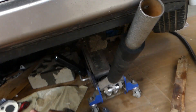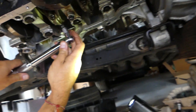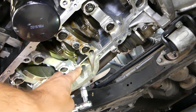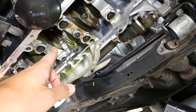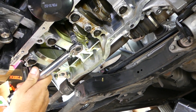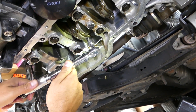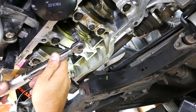We need to bring the piston all the way down so the connecting rod is down and you can see the two bolts. Those two bolts need to be new bolts every time you remove them — that's what the manual says — and you need to apply oil to the bolts before you screw them in. We already got them hand-tight, and now we use the torque wrench. Listen for that click — right there.